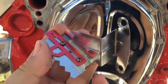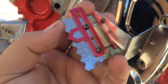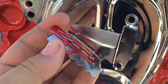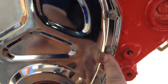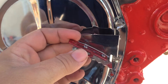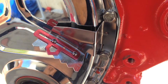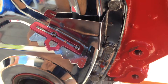After you have your timing cover installed, you may want to put on your little timing indicator. It's got little numbers on here to tell you where your timing is at, which is degrees before top dead center or after. We're going to pop off these two bolts here and put this on like that. Then after we put our balancer on, we'll be able to set our timing. There's our little timing indicator mounted on our timing cover bolts.